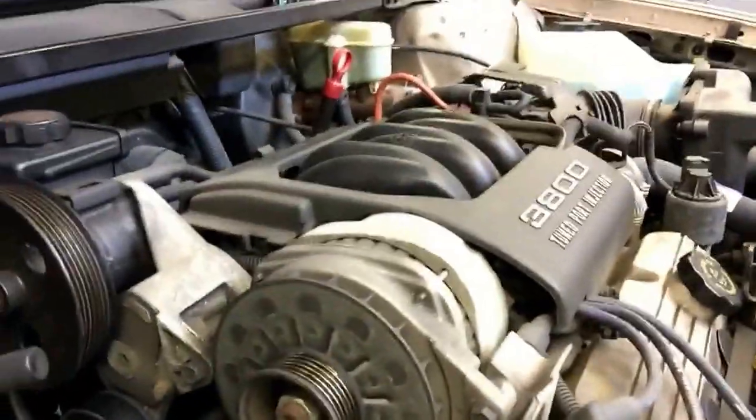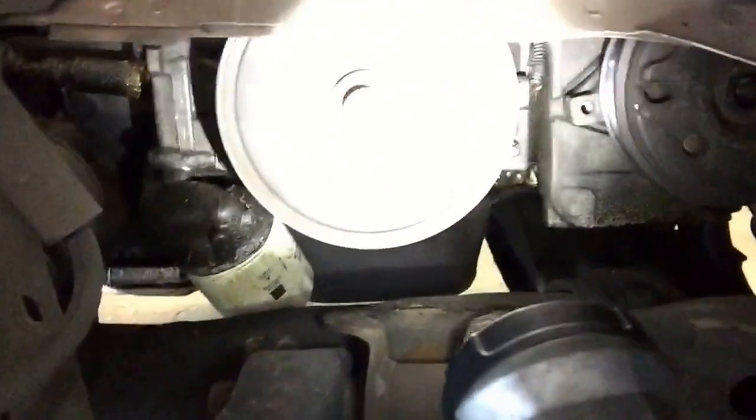Anthony, let's start this up. We're going to start up to see what we have. Did you hear the little ting going on? Down below, we're going to try and see if we can give it some gas and make it make some noise. You don't hear too much in neutral until you put it in drive, but let's look down below here — and there's the balancer. Shut it off, Anthony. Did you hear that little noise right there? That is separation.